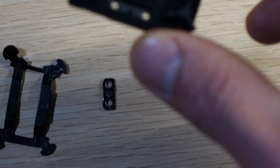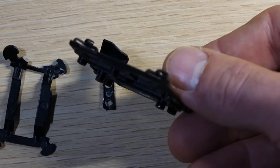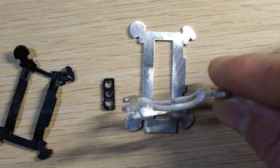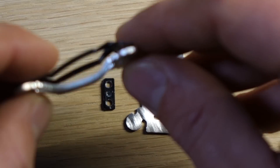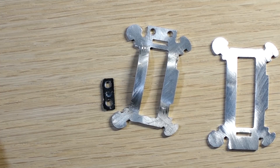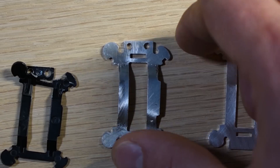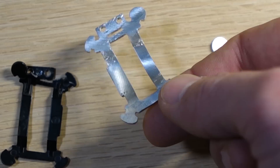It sits on this little plastic piece with these rubber bands. I made some measurements and I had these pieces of aluminum cut. It's 18 gauge aluminum. Ended up bending it because their casting is kind of bent with a few 45s on there. I just had the people that cut it — they cut it, then I drilled the holes manually and bent it manually. These reproductions ended up being really close to the same size, but a good amount heavier duty.